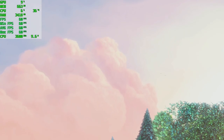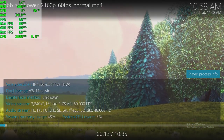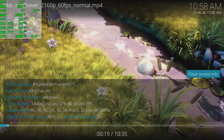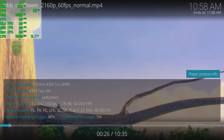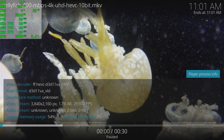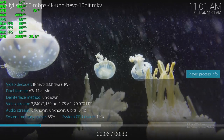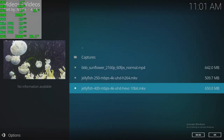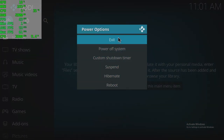Next up, some 4K video playback using Kodi. This is a 4K MP4 at 60fps — my go-to test, Big Buck Bunny. No trouble here; it's super smooth playing natively. So if you want to stream from Hulu, Netflix, or YouTube in 4K, as long as your internet can handle it, this PC will be fine. I also tested the Jellyfish test at 400 Mbps — 4K UHD, HEVC, 10-bit, 60fps. It ran really smooth but I had some trouble finishing it, though that's a super high bit rate and the average person will never use something like that.